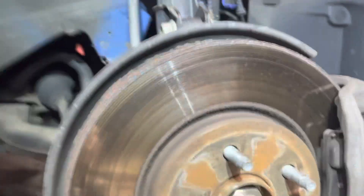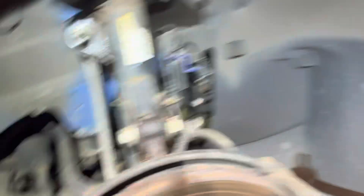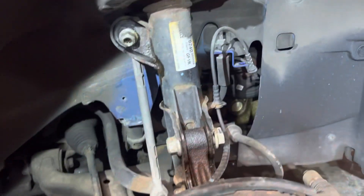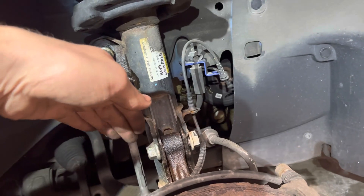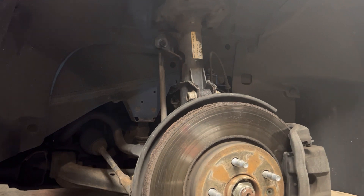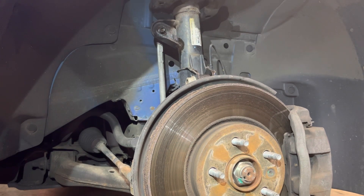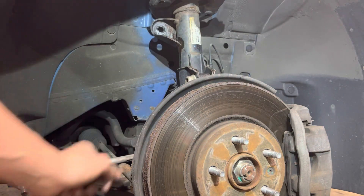Get this nut off. Then with the jack, lift up the entire suspension — it will go from pivoting down to level — and then you can pull the end link out. Lift up on the knuckle until you see it moving. That just takes the spring tension off and now you can drop it off. Then drop it all the way back down.